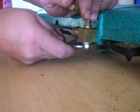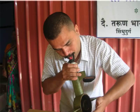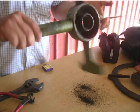Now we start dismantling the burner. Next we will remove the debris in the burner. As shown in the image, blow air through the hose burner connector. This will also help to check if air is reaching smoothly to the flame ring. Slightly tap the burner and then turn it upside down — you can see the debris fallen from the burner.